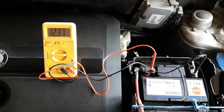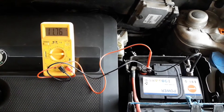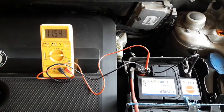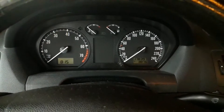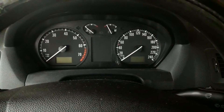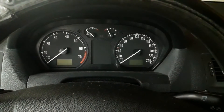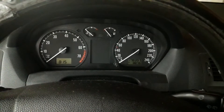The most important reason for knowing how to test a car battery with a multimeter is that you'll be able to determine with good accuracy what is causing the problem. For instance, and this is perhaps the best example, is when the car poorly cranks. The causes for this problem range from a bad connection on the battery terminals, a bad battery, a bad ground connection, and go all the way to a faulty starter — a wide range of possible causes. But by using a multimeter, you get an instant starting point or even the solution to the whole problem.